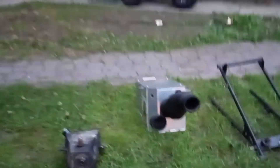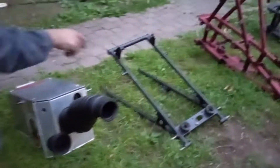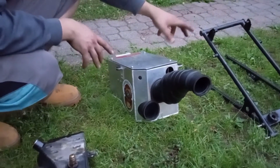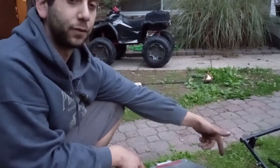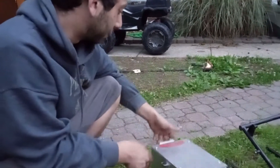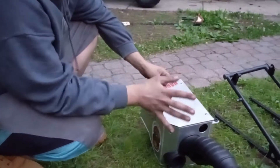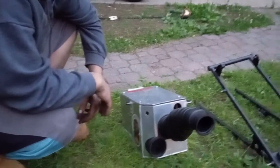I got an aluminum air box for him because he wanted to go with the Lone Star subframe. You need to run an aluminum box on the Lone Star subframe for the 400EX because there's no battery mount on the side of the subframes anymore — it deletes all that. You'll be able to run the battery in there, the solenoid, and the CDI box, and keep all that dry from the weather and water when he's riding.